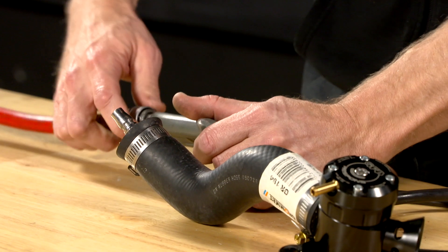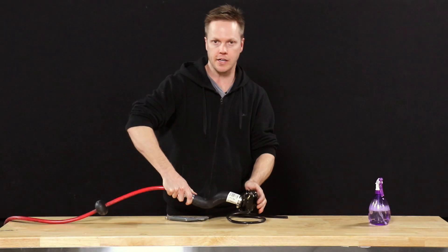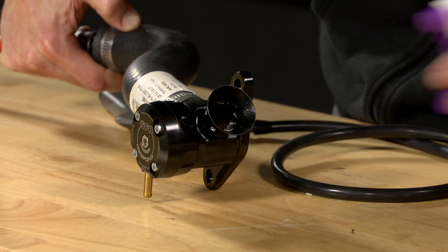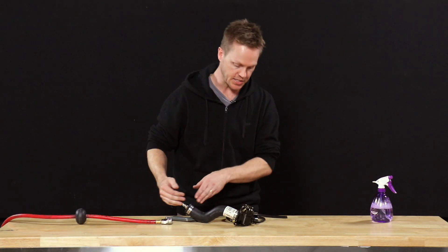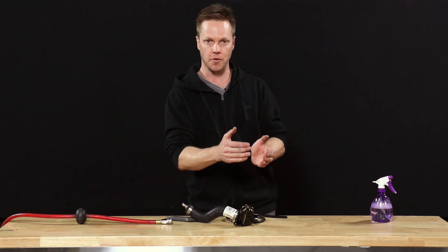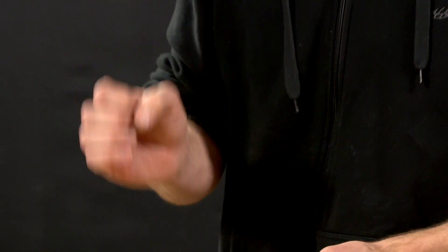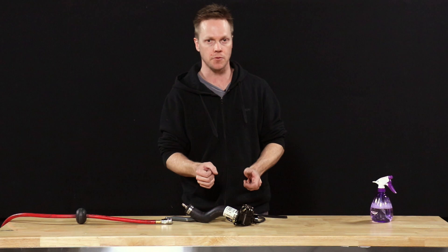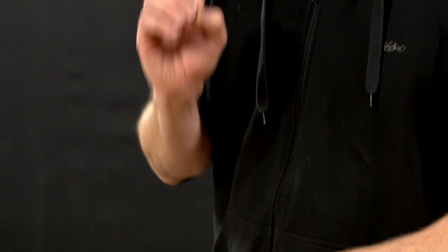We'll put some pressure on the recirc — I'm using about 15 psi. Already I can hear a little bit of a leak, so it's quite easy to see when we put some soapy water in there; you're going to see a few bubbles coming out of the trumpet. So basically what we're seeing there is air going around the side of the piston. It is just not possible to seal the sides of a piston, and the gap we're talking about is about 0.02 millimeters. It is tiny — the bubbles make it look worse than it is.